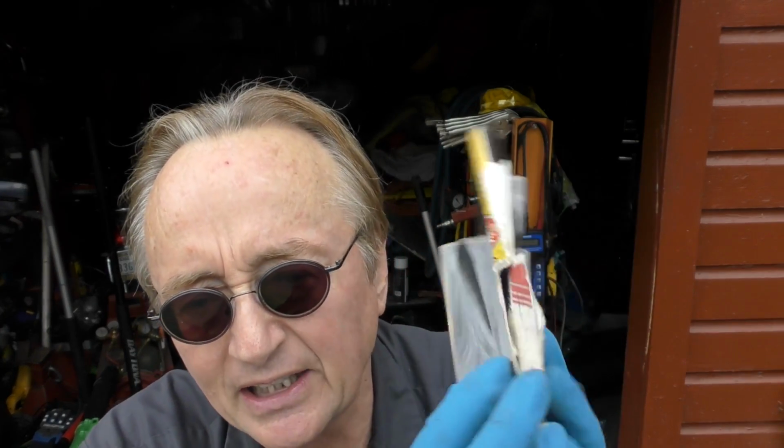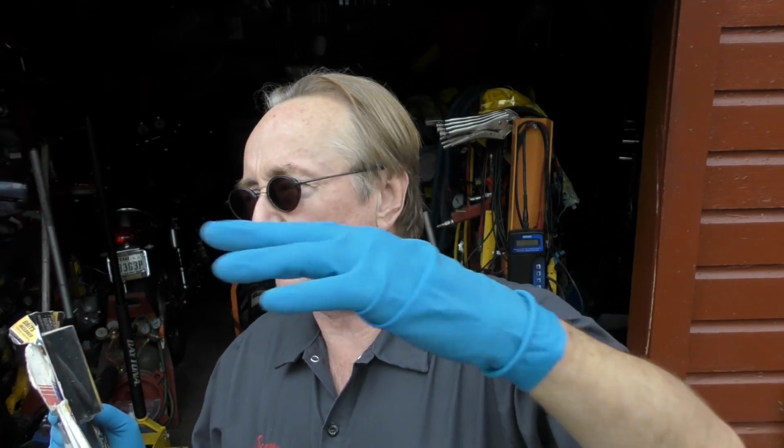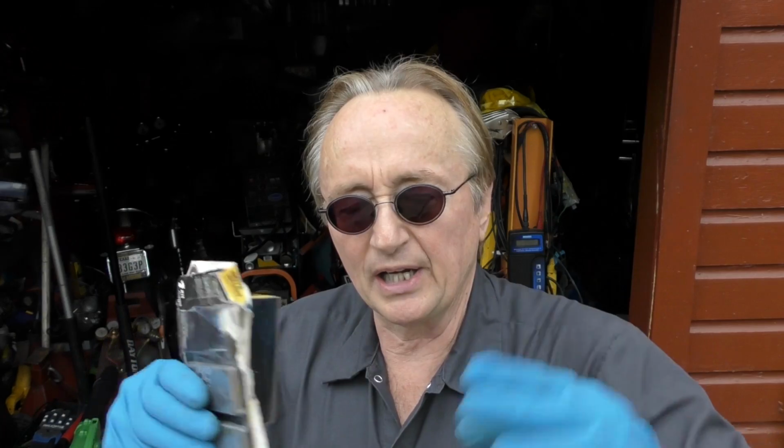And these cool little holders are great because when you're sanding, you just grab this and pull it, doing it by hand, pushing down. Of course, your fingers aren't that even. This thing's flat. It's going to stay flat. You ever going to do any kind of sanding like this? These little kits cost hardly anything, but they're so handy when you have to sand stuff down. I've used these when I'm working on an engine. The engine head is really dirty and a little pitted. You can use this to sand them down smooth, then put a gasket on, and you know that it's going onto a flat surface.